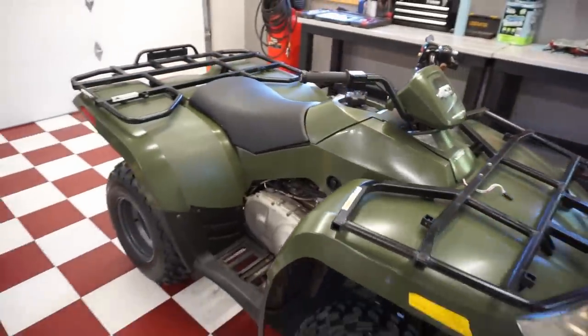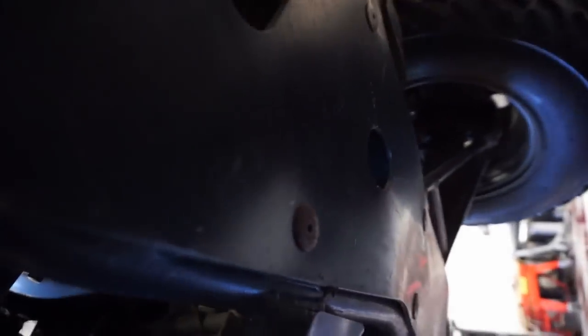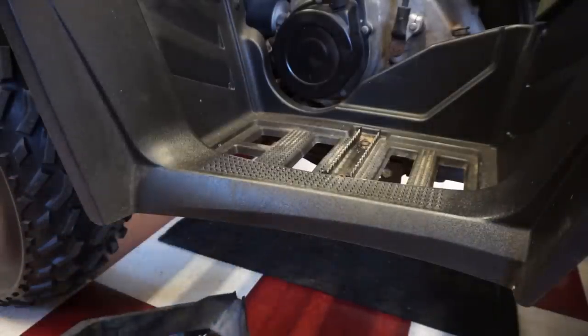It's looking pretty good and pretty clean. Let's drain the oil next and get a new filter in there - this thing definitely needs it. The drain plug is down underneath here. Let's get that out. Vinnie wants to help it looks like! No metal or anything in the drained oil. Just got the old filter off - it's an Emgo brand, never heard of that before. The oil itself drains out pretty black - probably hasn't been changed in a while.